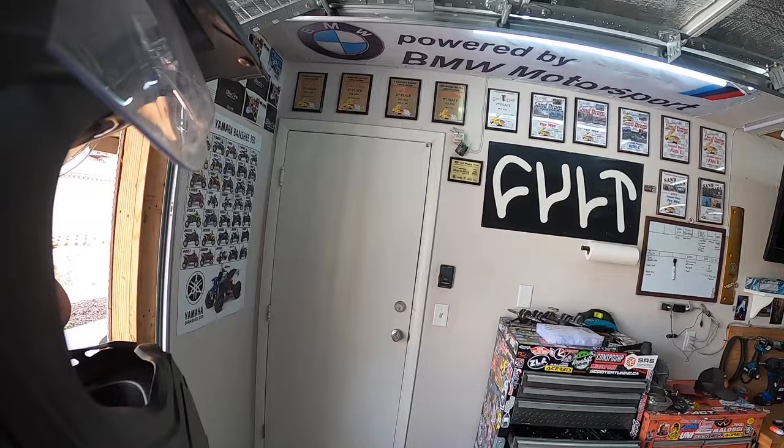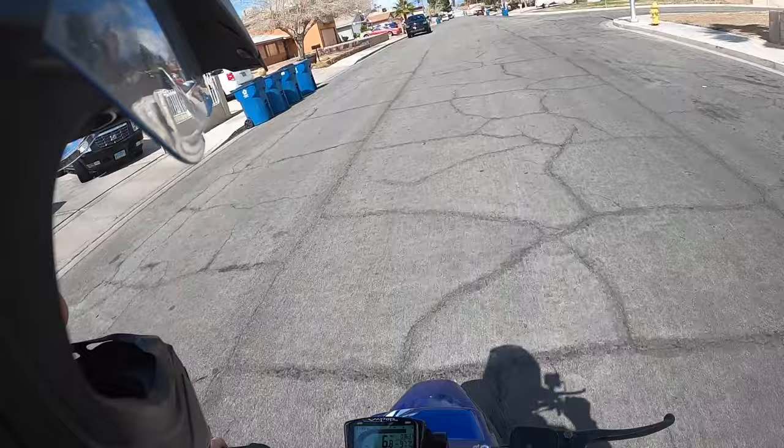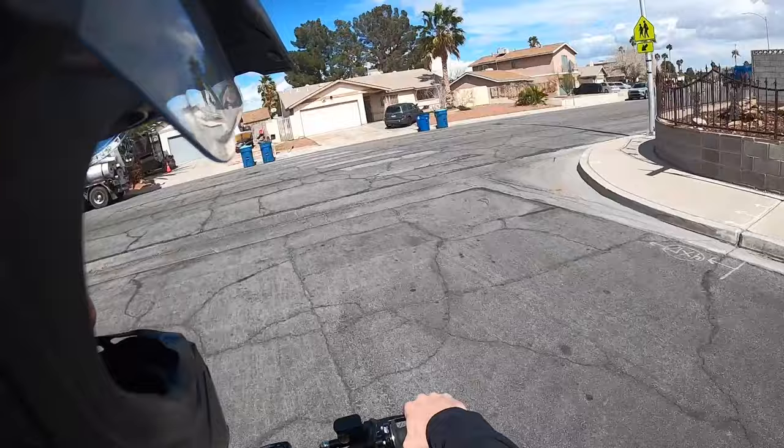Boys, I'm excited to try it now. Stage 6 contra spring in it. Stage 6 variator in it. 3AA front plate. Same weights. Takeoff changed drastically. Definitely has more top end now with that stiffer spring because it's opening probably a lot slower. But man, the takeoff changed drastically. No longer just pulls the front wheel up, that's for sure.